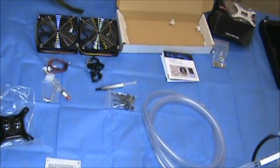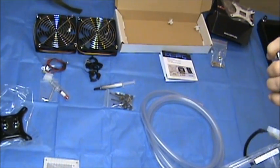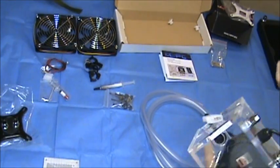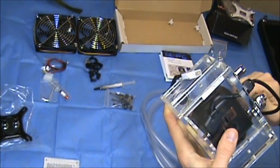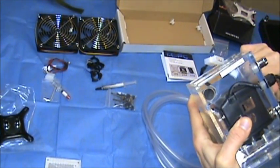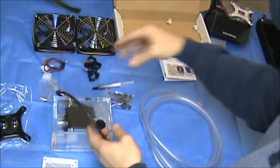The acrylic pump — it is basically plastic. You don't want to crank because you'll not only strip the threads but you could also crack the entire reservoir surrounding the pump. So again, you want to be very careful. I found it really easy to just hook all these barbs up before I started piecing things together, so I had everything laid out.